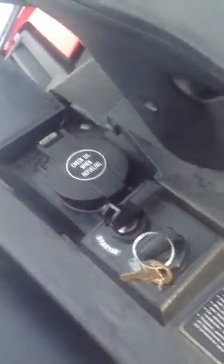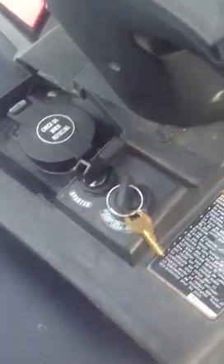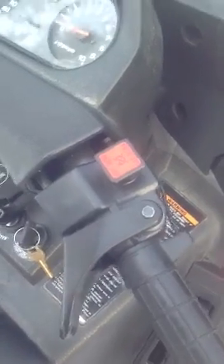Or one pull. Then throw the choke back up so it doesn't drown it. When you turn off the snowmobile, turn it off with the key. Not with this push-pull engine stop lever — try to leave that alone.